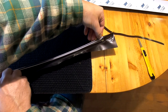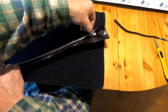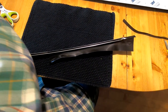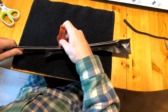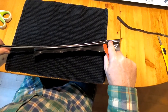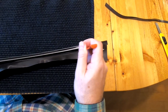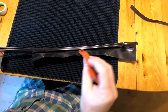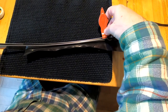Use your fingernail to fold the vinyl material around the raised edge, going back and forth rather than all in one motion. Then switch to the specialty tool and use the hook end to curl it tighter. Stop short of the far end — don't pinch it down completely yet, because you'll need it open when doing the final detailing. Work the hook all the way under, then smooth the material out on the inside, stopping just short of the far end.